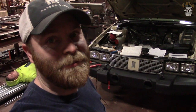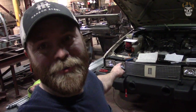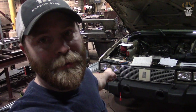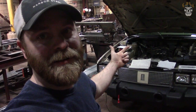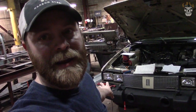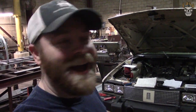All right, rednecks, it's been about probably 2 hours of us screwing around with this, and I done messed up. This car doesn't do exactly what I thought it did. The 194 bulb on the side has dual powers. It uses the power from the running lights, and it uses the power from the turn signals to make that blink. The turn light at the bottom corner doesn't come on how I expected it to, and the turn signals don't work how I expected them to. So all of this was an absolute waste of time.